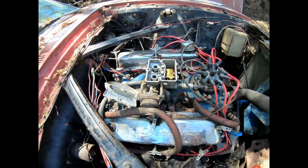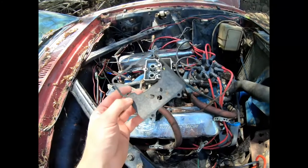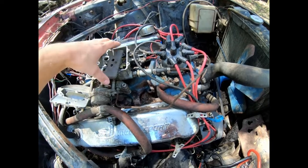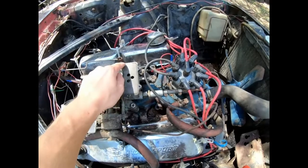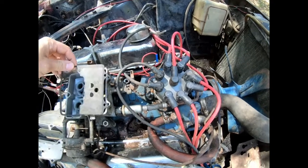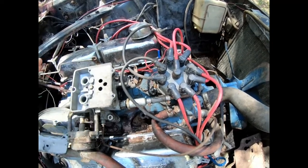So here we are the next day after that video I just took. I went ahead and pulled the top off and pulled this gasket off, and you'll notice it's really dark on this side. That's because they had the gasket sitting like this up here. There's a big gap — you can see a huge gap. That explains why the fuel was running out on that side: the gasket was flipped upside down the wrong way.